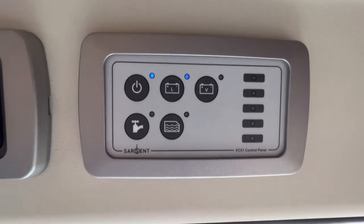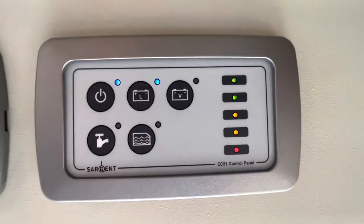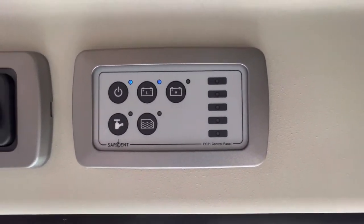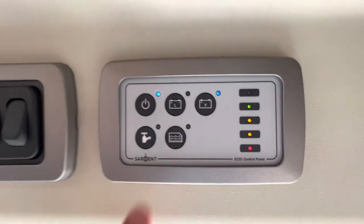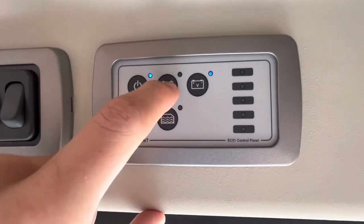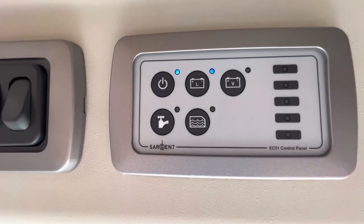On the top of your control panel, you've got your master switch which turns the vehicle on to 12 volt, or if you're hooked up you'll get 230 volts. Press Battery L — your leisure battery — to view the battery reading; you can see it's fully charged. Take the hook-up out to get a true reading. You can do the same with the vehicle battery, but make sure the habitation is using the leisure battery, not the vehicle battery, as indicated by the blue light — that could flatten your van battery. So turn it back to Battery L, which is your leisure battery, and it will use the designated battery to operate the habitation area.